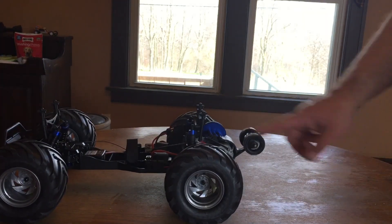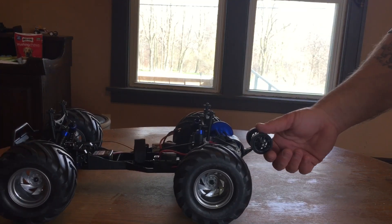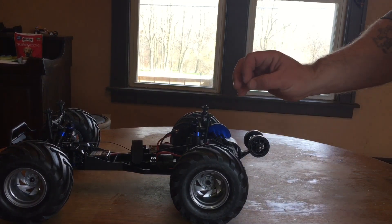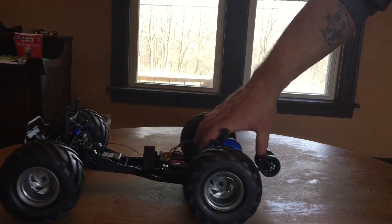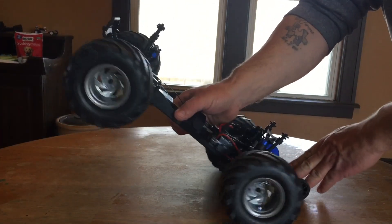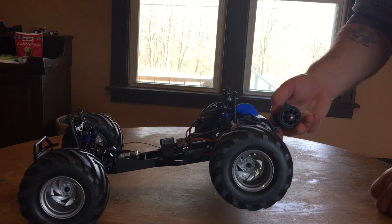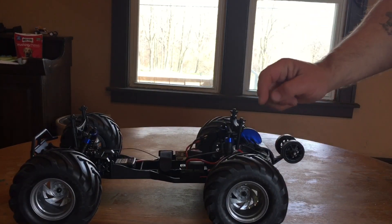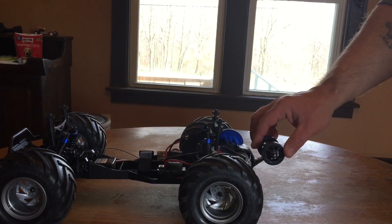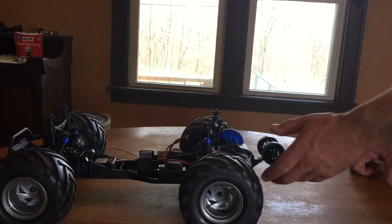The truck comes with a wheelie bar, and the wheels on the wheelie bar are coated in rubber — a nice touch. With plastic wheelie bar wheels, running on pavement with bits of stone and gravel can dig in and warp the plastic, affecting wheelies. The rubber wheels should avoid that issue. I'm not 100% positive, but I think the stock motor is a 20-turn. Running 2S LiPo on the buggy, I found the setup quite capable out of the box.